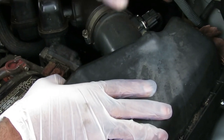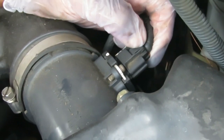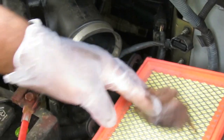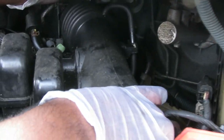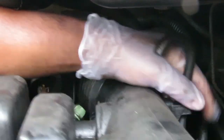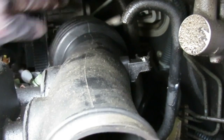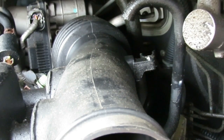This clamp is loose so I can try to bring it off, but it's too tight. We're going to have to disconnect this sensor right here - this is called the mass airflow sensor. You see the little plug with a little tab? Squeeze that tab in and unplug it. Now we're good to go. This clamp is already loose so now we pick up on it and bring that piece out of there - that's the top half.